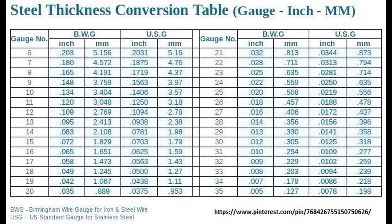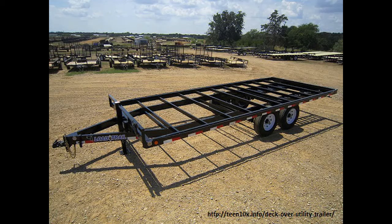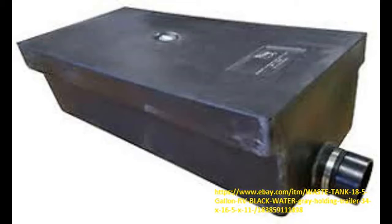The next thing I would consider is how thick the aluminum skin on the trailer is. You want to make sure you get an aluminum skin that's thick enough to do the job. I've also heard people suggest 16-inch centers on the beams that go across the floor underneath the plywood — I would be cautious about that. If you intend to put tanks underneath, make sure they fit within 16-inch centers before you buy a trailer built that way. Mine has 24-inch centers, and my gray water tank matched up with them.